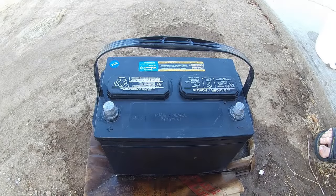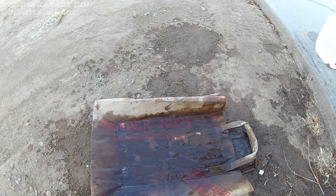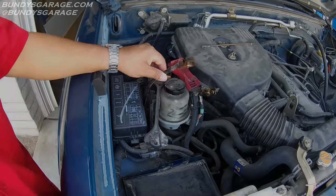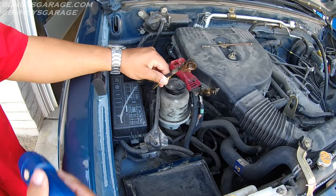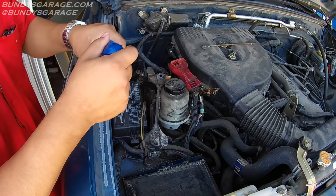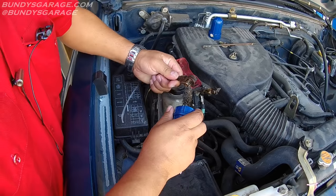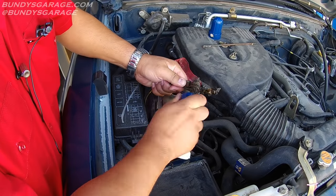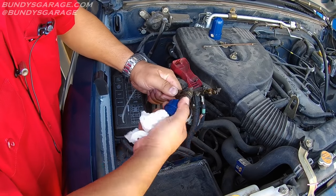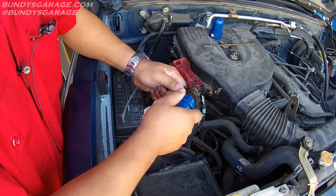So that's how you clean the acid off a battery and get the battery post good. We'll go back to the vehicle and put it back in place. The battery cable terminal is also a little bit corroded. So like I said, we're going to take the metal Christmas tree and clean both the negative and the positive cables.